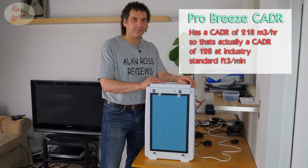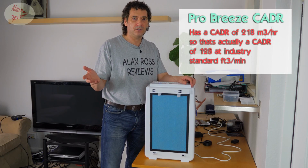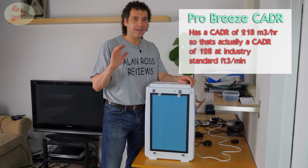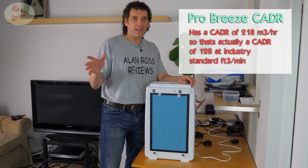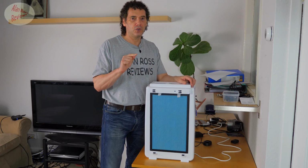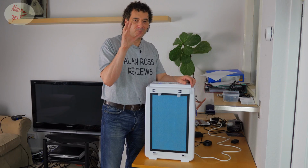So if you go to something like, and I'm going to say Blue Air, because I have a Blue Air, which is one of the better, better recognized makes, where everything is presented in industry standard format, they will quote the CADR either in its native form, cubic feet per minute, or cubic meters per hour, labelled that way. So you know exactly what you're talking about.